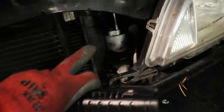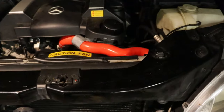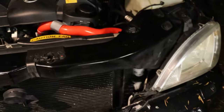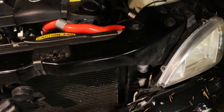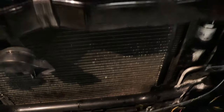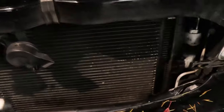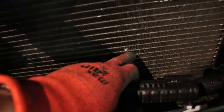This is where it's weeping from on the driver's side. We also need to get our condenser out. The AC on this car isn't working great, and considering just deleting the condenser and all the AC-related setup in the front. The only reason to leave it is it does provide a little bit of protection for the radiator — you can see gouges there, which might actually be why we're not holding freon.